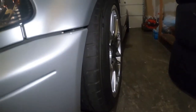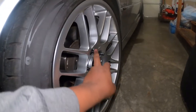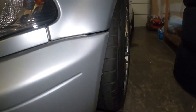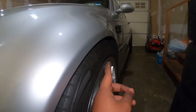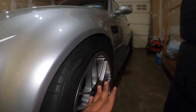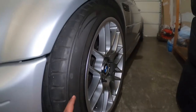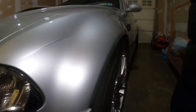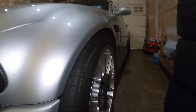I am done. You can clearly see the difference. I put 10 millimeters here on the front and now you can see the poke of the wheel stud — it's looking beautiful. It's not totally what I wanted; I'll probably need to put like 12mm here to close up a little bit of that fender gap, or when this tire is done put a 245 since I have a 225 right now — that would definitely fill up the empty gap.